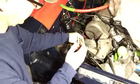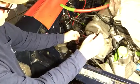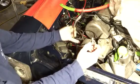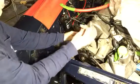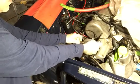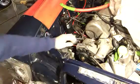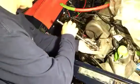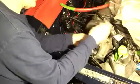Okay, as we put the adjusting bracket onto the alternator, I coated the bolts, since you find yourself either replacing the alternator or adjusting the belt or removing the belt, whichever. It's good to be able to get the bolts off. So I put anti-seize on the bolts where you will constantly be removing and placing, so you won't have to worry about rust problems. Now what I'm going to do with this one is pull it up snug but not tight. And this is 19 millimeter I'm using.